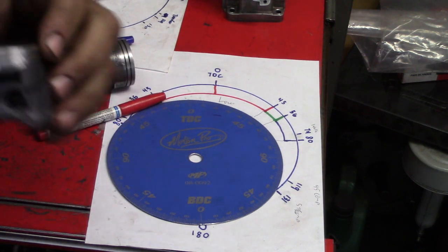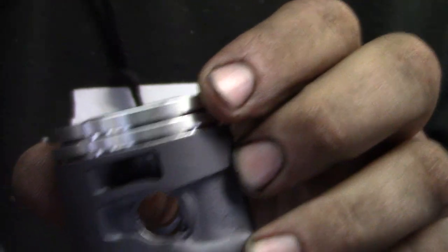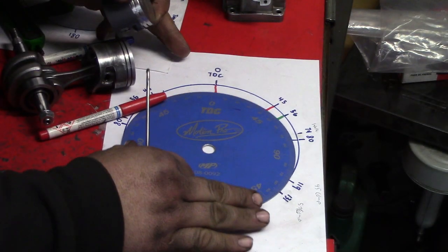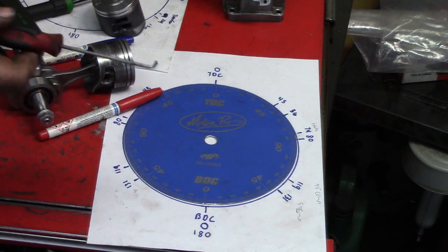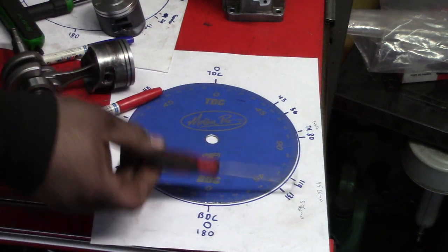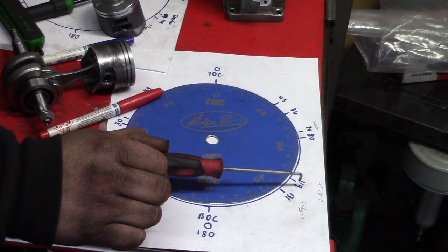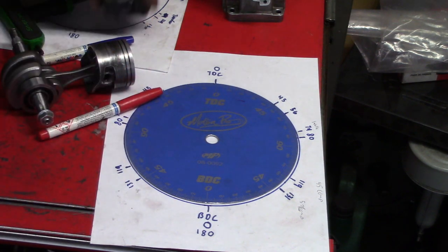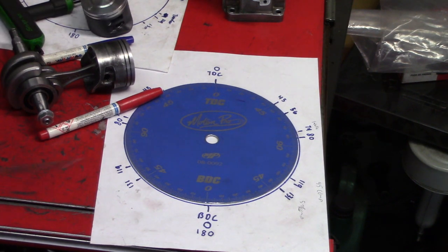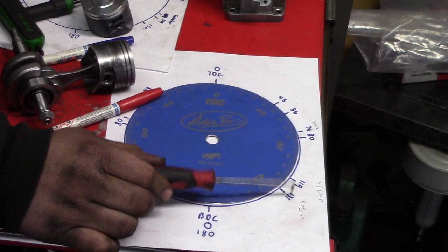What I think is actually happening is right in here, there's pressure being stored. So the longer your blowdown is — the OEM cylinder didn't have much guts, it was just weak — 119 degrees. That's when the upper transfer is open in relationship with the top of your piston. Short blowdown is 119 degrees. Long blowdown is very long — 131 degrees.